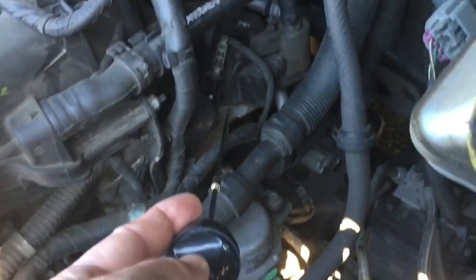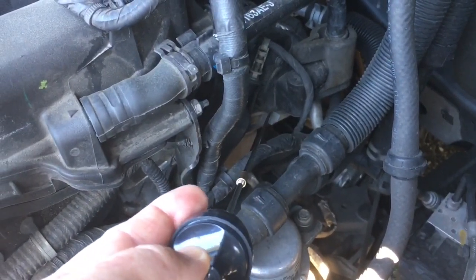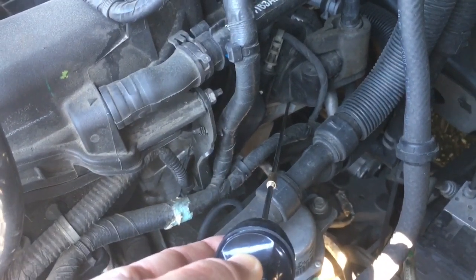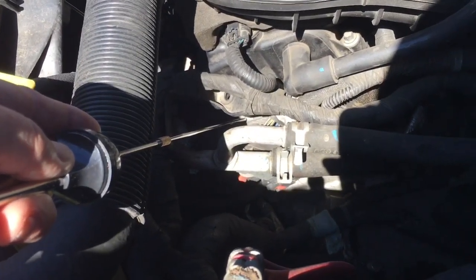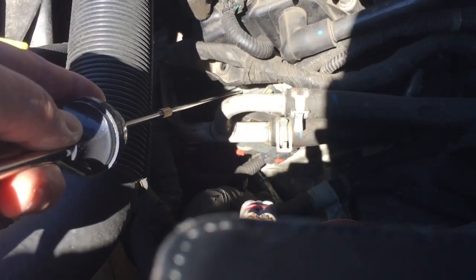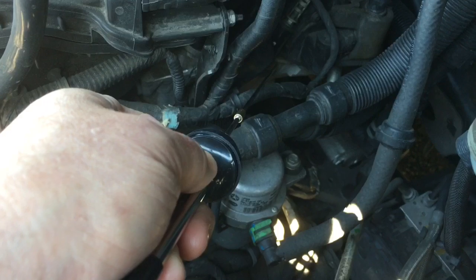The same for this side, which is harder to see because it's dark back there. You can just touch the head right there where it's attached to the valve cover, and listen right there as well. You can tell the difference — when you find which roller rocker it is, you can tell which side that tinging, pinging noise is coming from when you touch this thing on there.